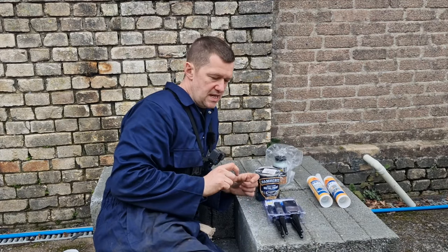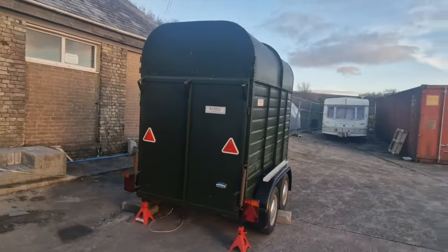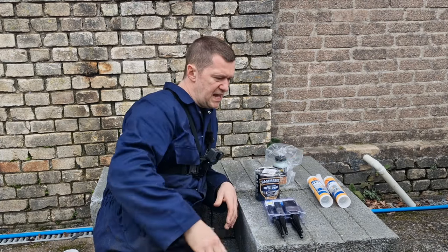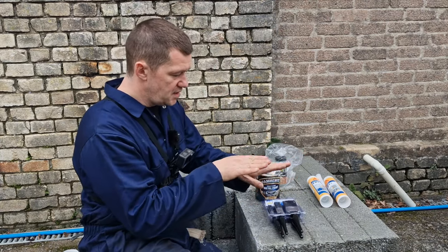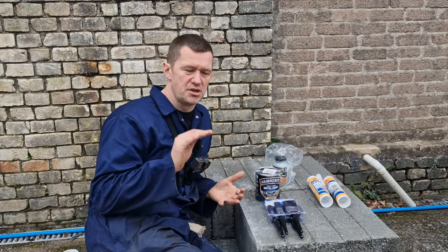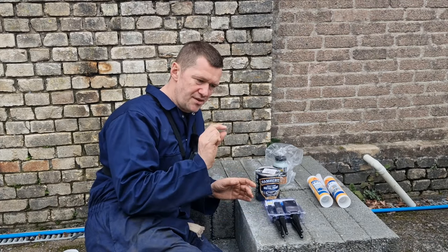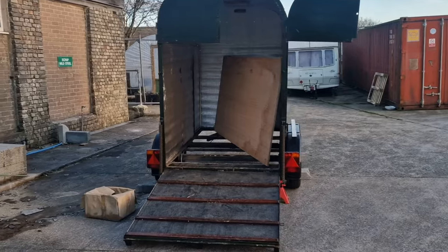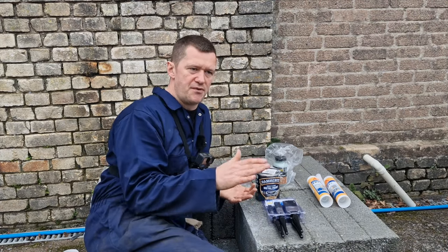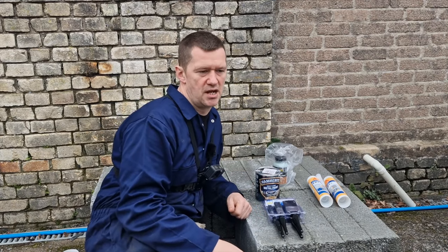As for the floor, what we're going to do is use the aluminium — I think it's 2mm aluminium. It's not very thick. Because of the size of the bottom in here — it's 230 centimetres long and 135 centimetres across — one single sheet won't actually fill it. So rather than just filling the edges, we're going to get two of the sheets, turn them sideways, cut them to size and then overlap them slightly. Then I've got some acrylic sheet to go on top — that's already got some foam insulation on it. There is a slight difference in the side of the box and the middle anyway, so that 3mm acrylic will actually help to level that out, ready for the 18mm ply. We will seal the 18mm ply as well, because it's going to get a lot of traffic. Hopefully it won't have a problem with condensation because the insulation and the acrylic will take that coldness away from it.